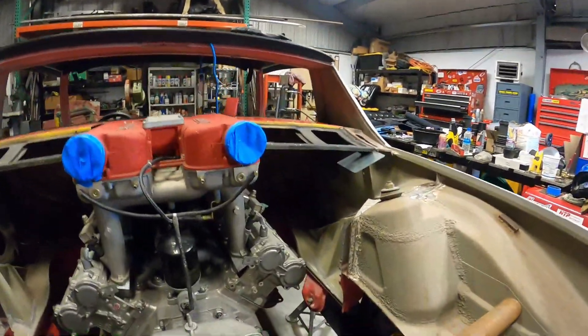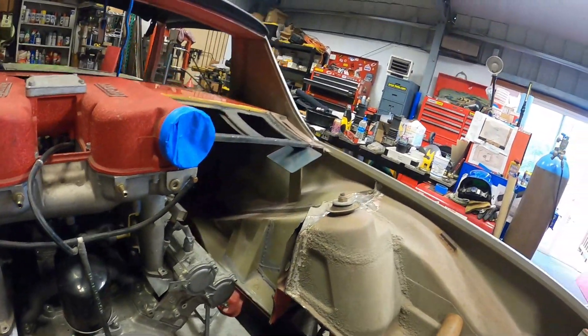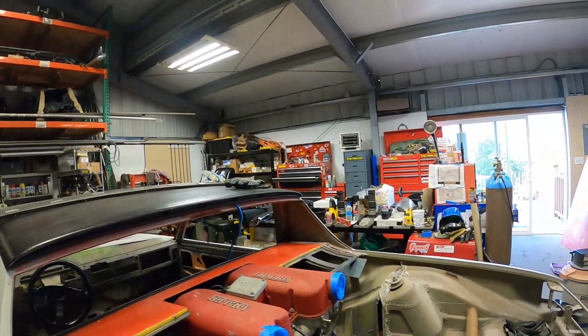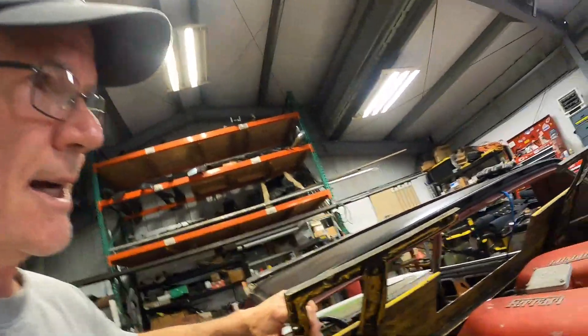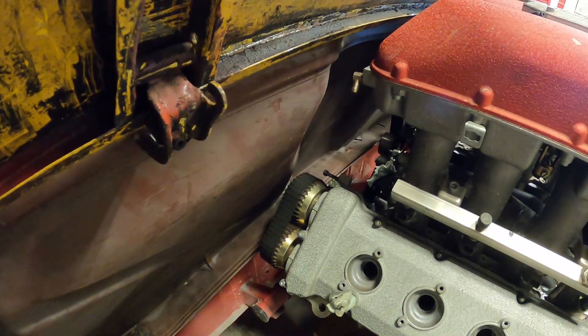Not a bad first couple of days. We're going to keep at it — it's going to get messy from here. I've got to pull everything back out from the bottom, lose the engine tray which is the sheet metal holding that rubber seal channel that goes all the way out to the longitudinals — the main chassis rails sitting back in there. Those all go away, and I'll stiffen that little piece of metal supporting the deck lid, which is all wonky now because it's been cut apart.